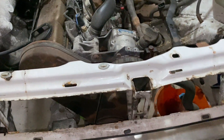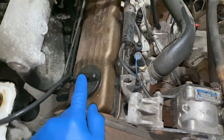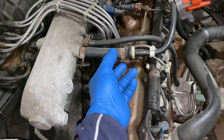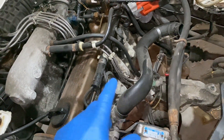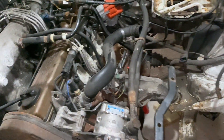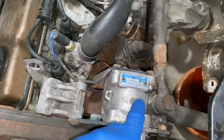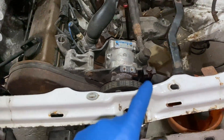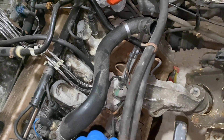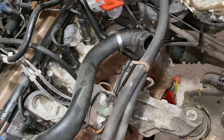Whilst we're in the engine bay we are going to be replacing belts. We're going to do a timing belt, which means these covers are going to come off and will be painted. We're also going to do a valve cover gasket because it's got a bit of a weep on it - that will be painted. To get access to the valve cover gasket we're going to have to remove these hoses, HT leads, plugs, distributor cap, and rotor arm - already done. We may as well replace the jubilee clips to future-proof things, and remove the power steering pump to create a little bit more access. I believe this is the cold start injector - that can be removed because to paint the block properly we're going to need a little bit more access.